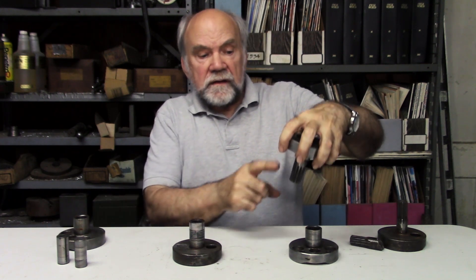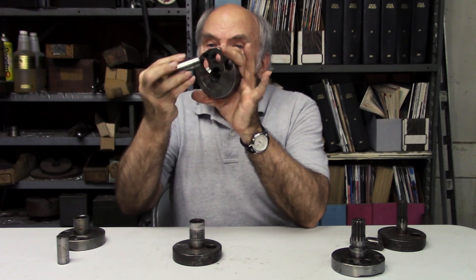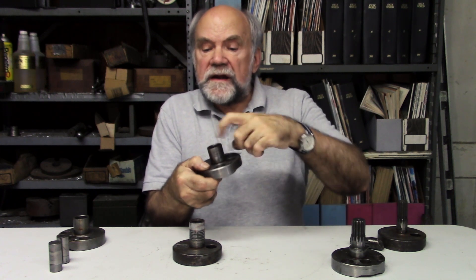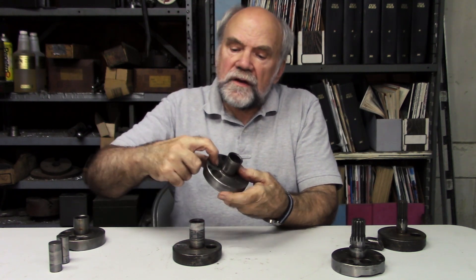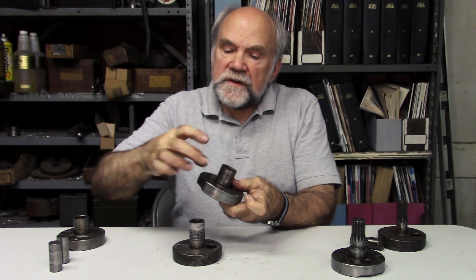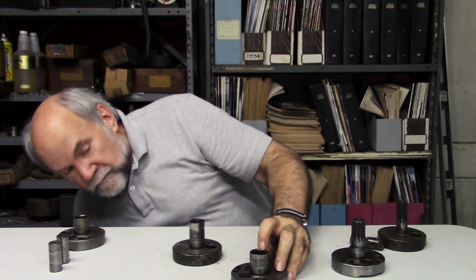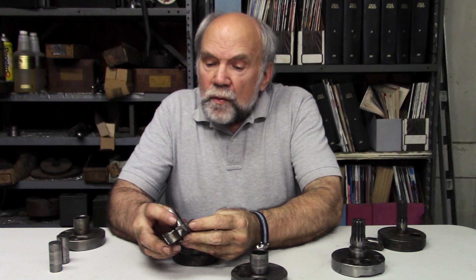This pressed joint goes together with a force of between three and five tons. Now, they were pressing this shaft into this hole, and then pressing a solid crankpin into this hole. The result was increased stress between the inner main shaft hole and the outer crankpin hole, causing a crack to appear in this little fillet radius — the join between the center shaft and the flywheel itself. And the result of that double increase was that on occasion, the inner flywheel on the TZ750 would break in two.